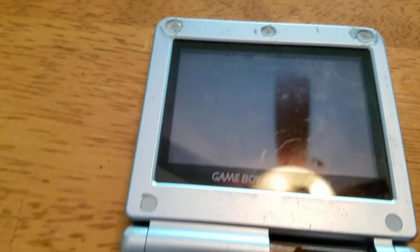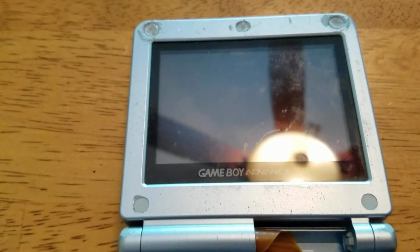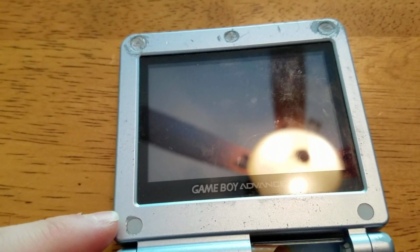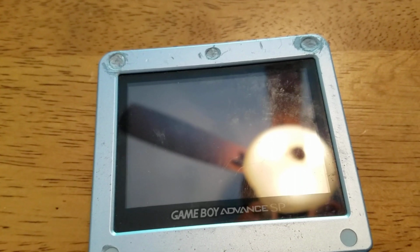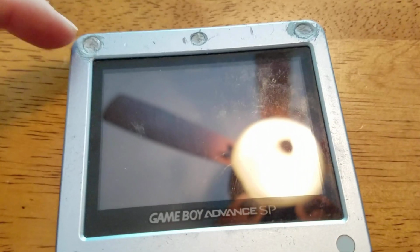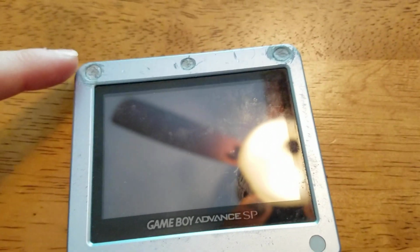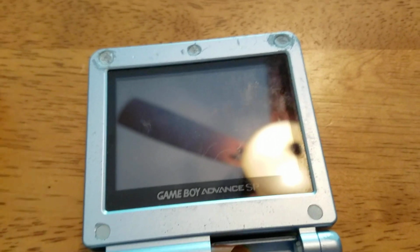A small flathead screwdriver would be your best bet at a safer version. Just be careful with where you're pointing it. You want to be careful when taking these off because these are stuck in there. So just keep in mind that those are in there and don't hurt yourself when doing this. So I'm going to take these pieces off, and there are tri-wing screws that are holding this screen together. So I'm going to take off these plastic pieces.